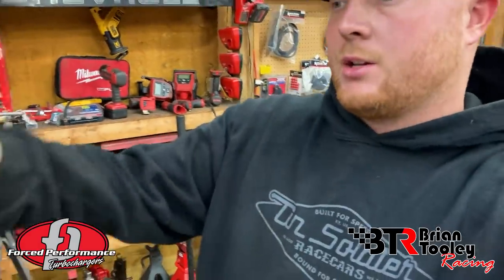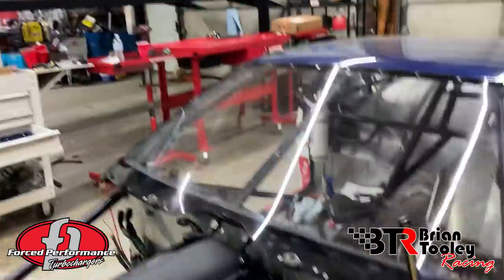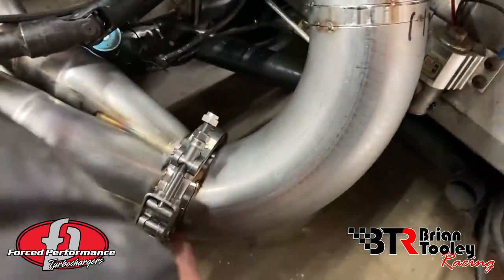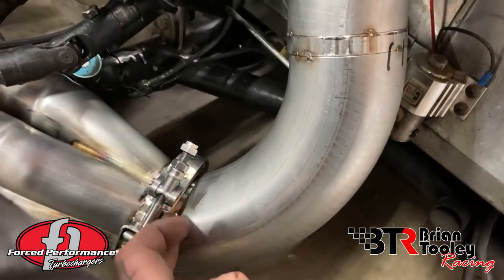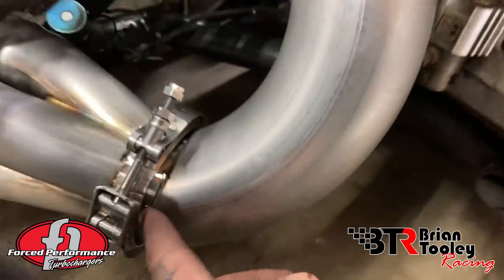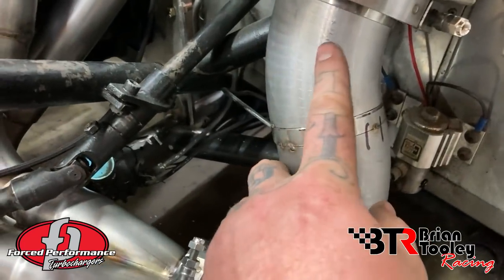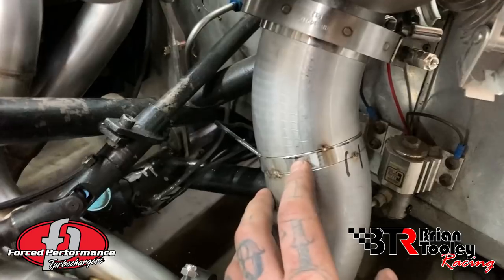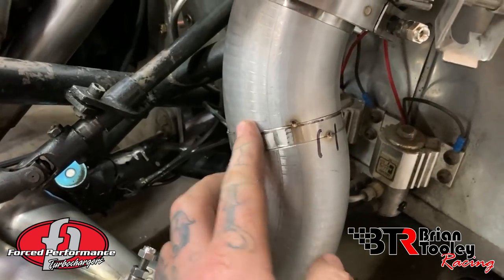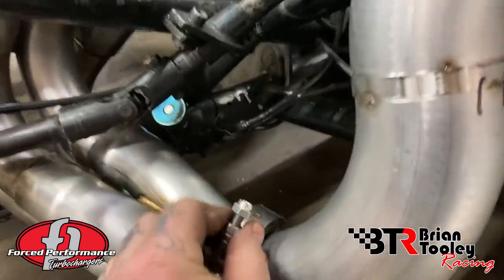I already knew what I wanted to do - come back and then go up into the turbo, which is why I made the headers where they were. It turned out really good. I got a 120 here that I had to cut a whole lot out of, really had to get into the radius - it's kind of oblong. I'll have to fill a little gap there but it makes it nice and smooth. Kicked it back with the 30. I tried to get another angle that already had a stub on it but I just couldn't get it right, so I ended up putting a little piece in there - Jason from 10 Soldiers and Brad always give me crap for doing that, but this thing fits so freaking good.